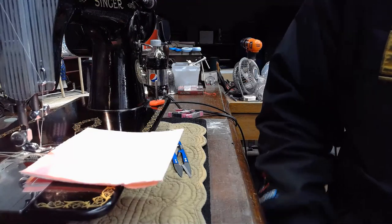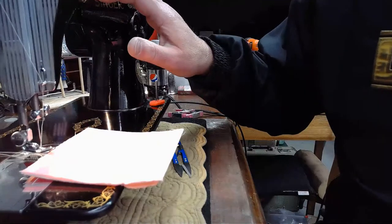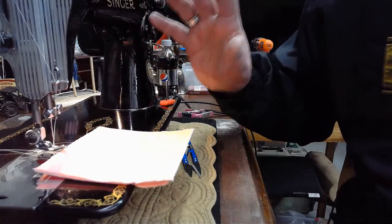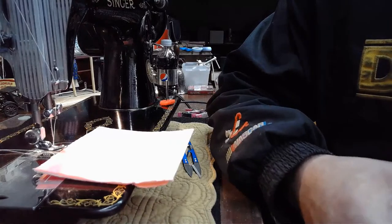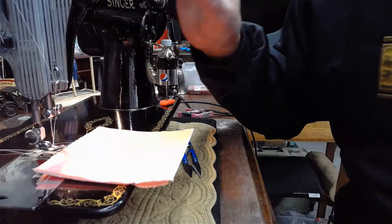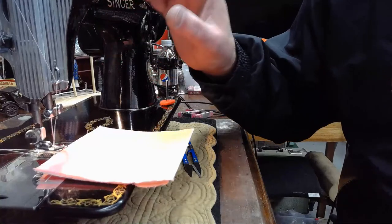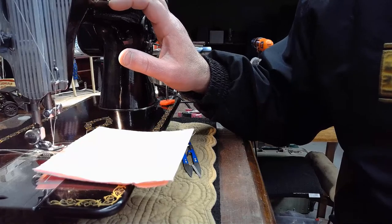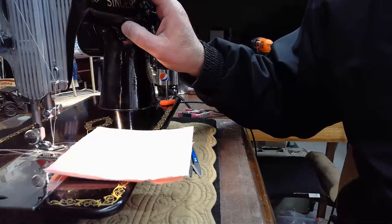So what I did for this Singer 1591, this machine again was shipped to the workshop from Clemens, North Carolina. It had been in storage for quite a while, and so there were just a lot of issues with the machine as far as being frozen up. Some of the wiring had degraded, so there was rewiring involved. There was deep cleaning involved as well, because there was also some rust that had built up inside of the machine. When you store a machine, even in some of these fancy places that say they're climate controlled, depending on the type of machine, it can still develop rust. And that certainly is the case with this 1949 Canadian-made Singer 1591. So, yeah, complete service, rewiring, reworking the motor as well. The motor had some issues going on with it.